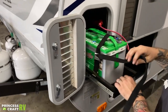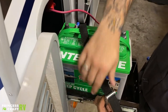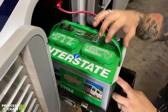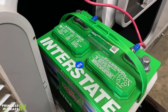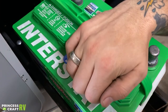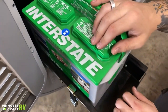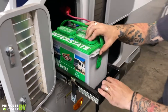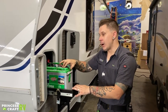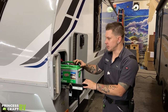You may need to use some caution when bringing that out because it is a tight fit with these straps. If we unstrap it, we're going to see these two vent panels. It's very important to get on a 90-day maintenance schedule with these lead-acid batteries — we're going to physically pull these vent panels off and inspect the water level. You'll see a clear marked water level and we do just want to maintain that. The correct way to maintain that water level is with distilled water, so keep a jug of distilled water with you. You will be topping these off generally in the hottest months of summer.